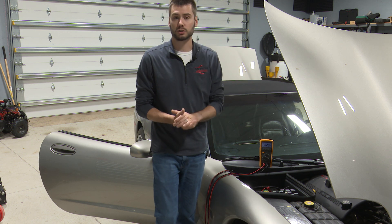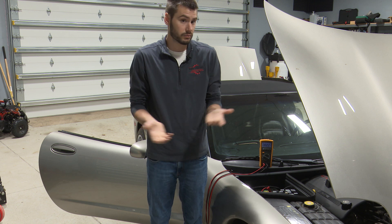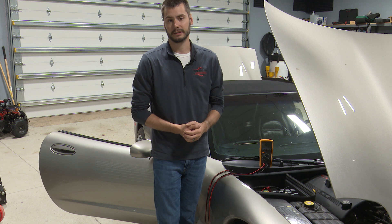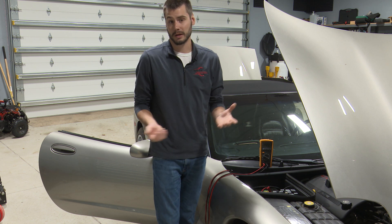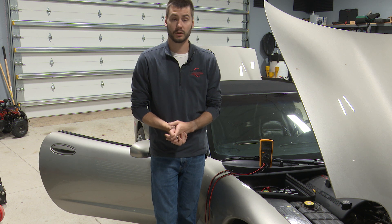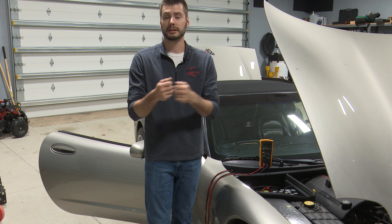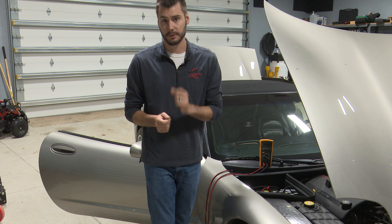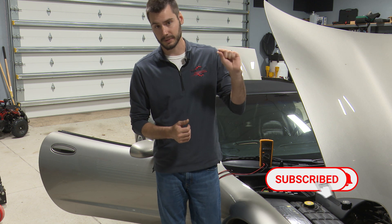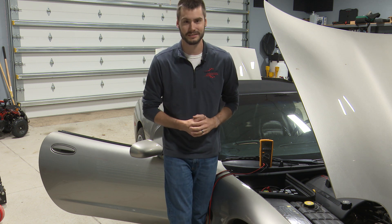So the driver's side seat module — this is a power memory seat on a 2000 Corvette, so chances are that assembly is going to be rather pricey. It's really up to the customer to figure out what he wants to do: does he want to dig in further on this system, or does he want to simply pull the fuse and let the seat sit in its position? I just wanted to get you guys to understand how to perform a parasitic draw test efficiently — voltage drop across the fuse is your quickest, fastest way to do it. Make sure you subscribe to the channel and click the bell icon. Happy wrenching everyone!